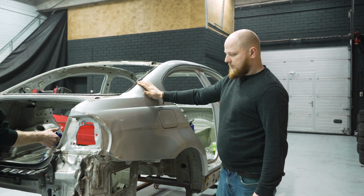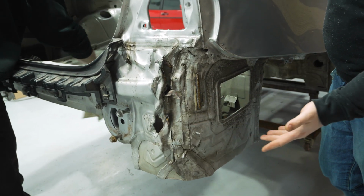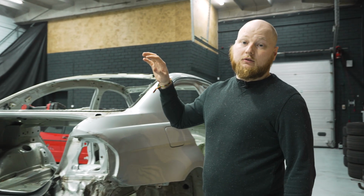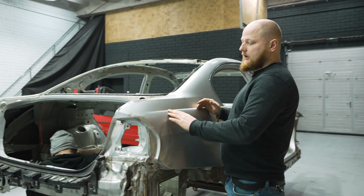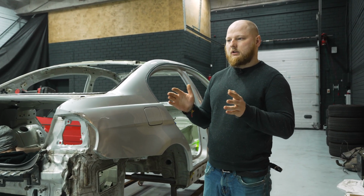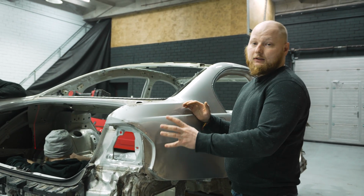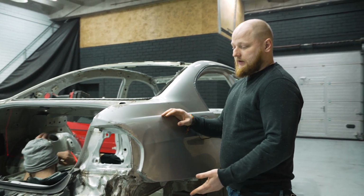It's time to finish up and cut off this damaged part of the rear end. Thank you, Norbe. You can take a look at what you did to my amazing car. So we have to cut off everything in order to save the rear end of the E90 drift car. And another important reason to cut off the solid rear end is every time you hit the wall, it's possible that your car is going to change the driving line, and you want to keep the way you were driving. That's why we are going to have fiberglass, carbon fiber, carbon Kevlar, or something else at the rear end.